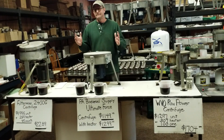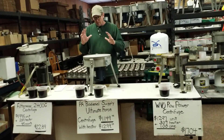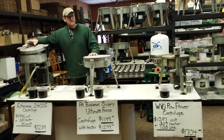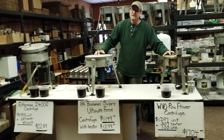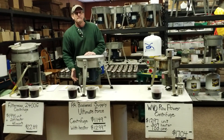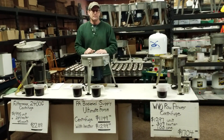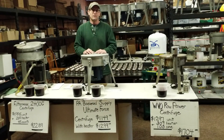If you buy an Ultimate Force from me, you get everything — all the fittings. All you need is hose. With FilterMax's unit, you don't get any of the fittings. And the forced ventilation — to keep water from going into your oil, you need to put a P-trap on it. None of us realized that initially; it wasn't until these units were out for a while that people figured this out.